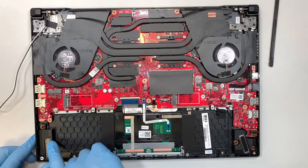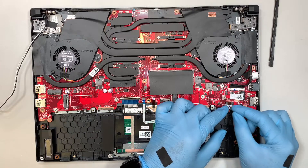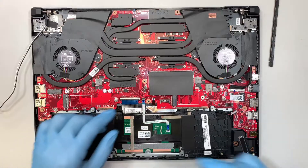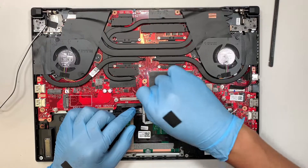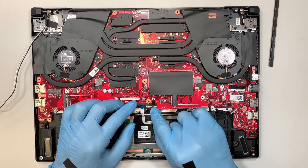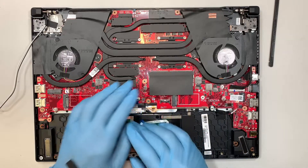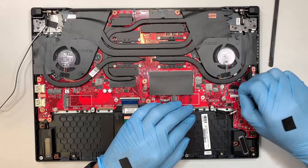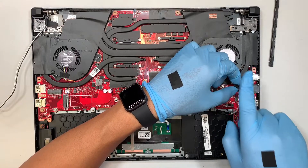Here is your speaker — the left and right speaker cables run along underneath to this connector. All you have to do is slide the connector down and it holds both the left and right speakers together. Here is your keyboard — you need to flip open the clipper and slide the flex cable down. This is for your touchpad — flip open the clipper, slide it down. This is for your keyboard LED light — open up the clipper and slide the flex cable down. Here comes the LCD screen connector, make sure you have the tape open, then gently slide the cable away from your body.